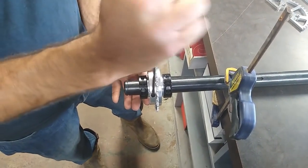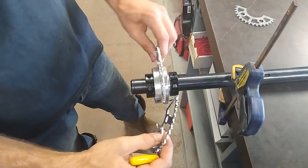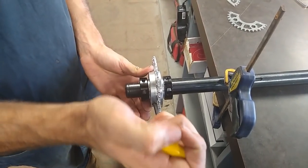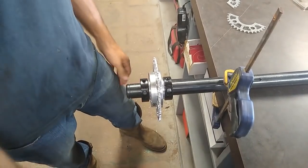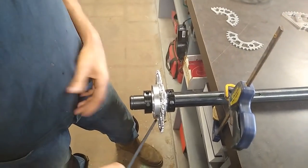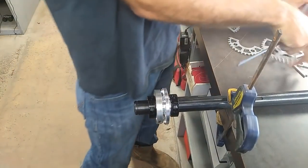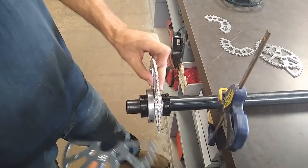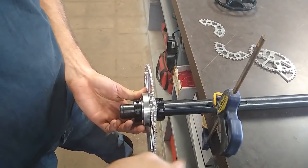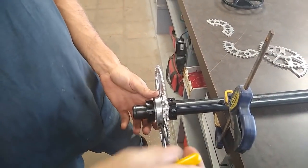To change it, it's just as easy as backing that bolt off, sliding the two gear halves off, grabbing your next gear, putting it on very hastily, pushing it over, and locking down the set screw again. You can't take off six bolts on a traditional hub that fast — you can't even take the right rear wheel off that quick. And if we needed to come in and do another gear change, same story: pull it off, slide it out, grab your 65 gear or whatever you're shooting for, put it on, slide it back over, and lock it back down.